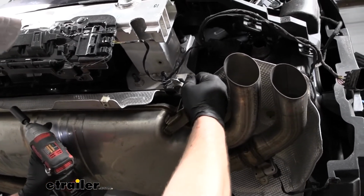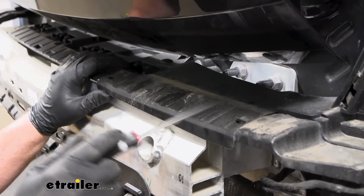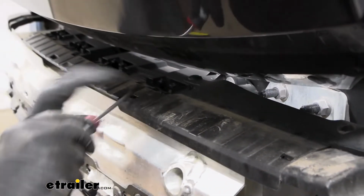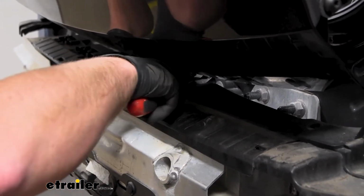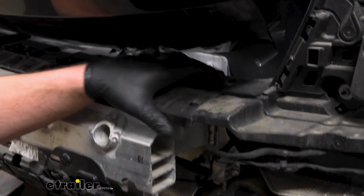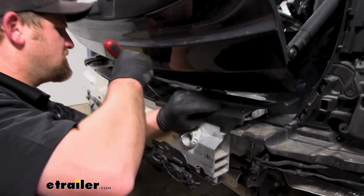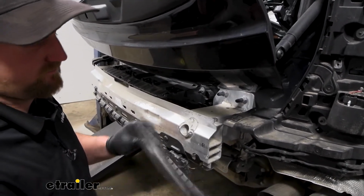On each side of our vehicle, on top of the bumper beam, there's going to be these panels. We can get them removed. Going to be held in place with 2 push-pin type fasteners. So at this point, you probably already know how to get these guys out. So that's what we'll do. Get them removed. And then you see these little openings in there, you may have to kind of take your screwdriver and work at them. So get that released and set it to the side.